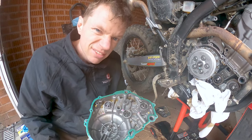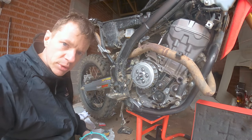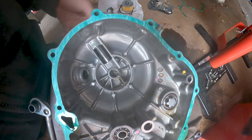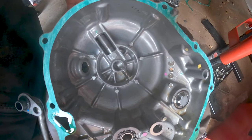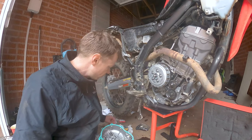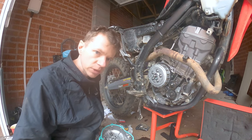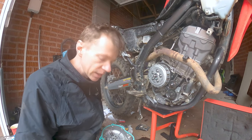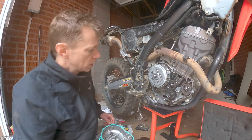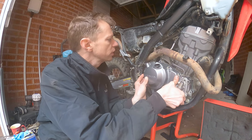I need to go around this carefully — this isn't coming off as cleanly as the engine side — so get an old razor blade around it and clean it right up. New gasket on the cover — a couple of things worth noting: if you pull up on the clutch release mechanism too much, that spring will come out of the hole. It's pretty easy to relocate, just be mindful of it. Also, while the cover's been off I've released the oil filter cap, cleaned that up, and we'll replace the oil filter while we're at it.